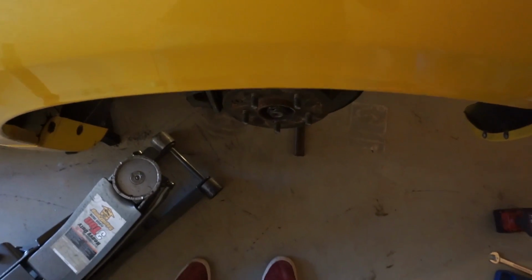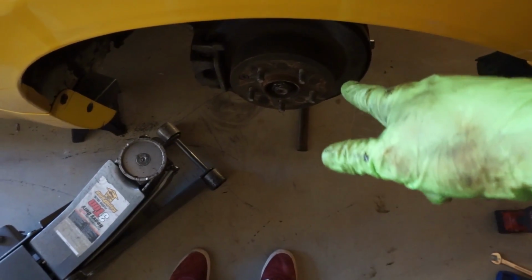So now I have to go around and just tighten all these bolts here, because these are still loose. And then I guess it'll be time for the eyeball alignment. Alrighty, I can tell the toe's out a little. You can kind of see that it's definitely more out in the rear here. So I can extend that front traction arm or whatever. This side was pretty close, but I did mess with it a little bit, and now the toe does look a little bit messed up too. So let me tighten all the rest of the bolts, and then we'll start with an eyeball alignment.